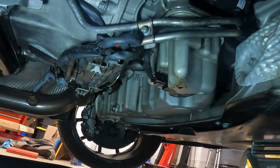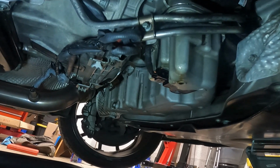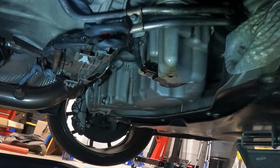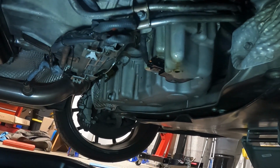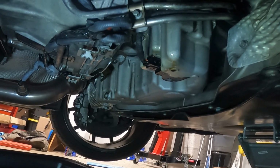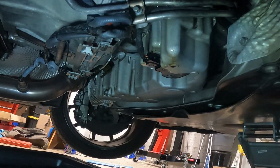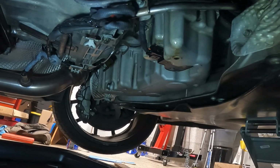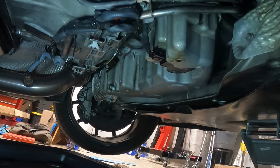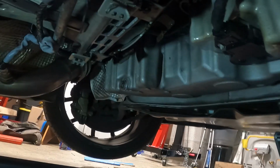While I'm also doing this, I'm going to replace the oil level sensor because I found a good one from the junkyard that actually reads. This one is not working, so it failed quite a while ago, and I've been getting an annoying oil level message light since I've had this car. I plugged the new one in the other day to confirm, and that solved that. So I'm going to drain the oil now and let this thing dry out, brake clean it like I said, and fingers crossed I can come up with something to get this thing to seal.